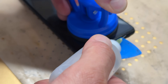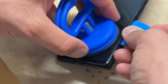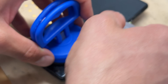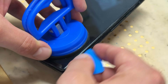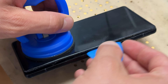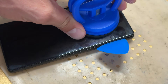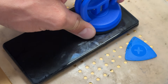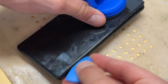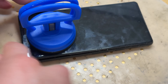Insert a plastic tool and add some isopropyl alcohol into that gap — flood it. We're not going to do much damage with some isopropyl alcohol. You might hear some clicking and cracking — clicking is good, cracking is bad. The screens on these are quite fragile so do take your time, but once you've got it warm enough and created that gap you should have no problem removing the screen. You may also find it's pretty dirty — this seal doesn't do a very good job, and I would not risk ever taking this near water.